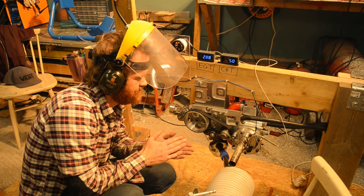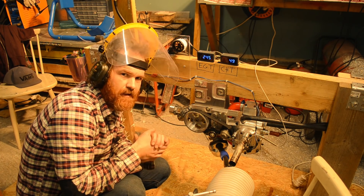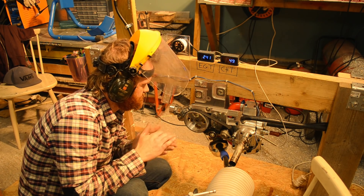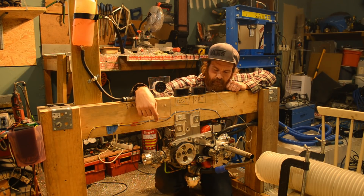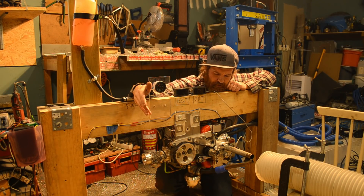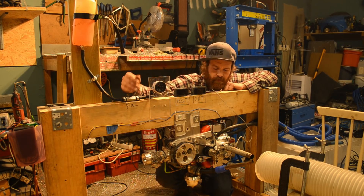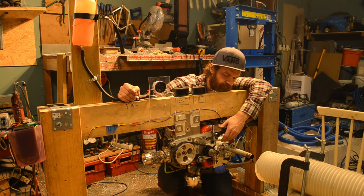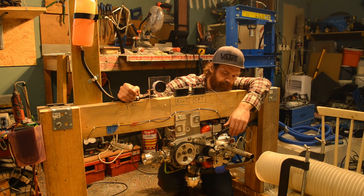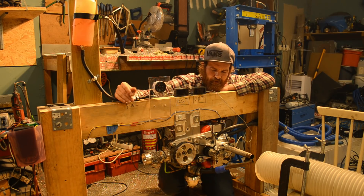Yeah! Need to fix that leak! That's better than last time! We'll have to call that a success — none of the replacement parts for the leaky bits leaked. The leak between the rotary valve cover and the cylinder — I knew there would be, there's no sealant there. But it's not a crucial area of the engine. It does show that the rotary valve works though, because there's enough pressure to push liquid out behind the valve. It runs much better now without the leaks and the lower drive ratio.